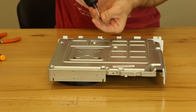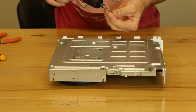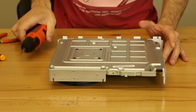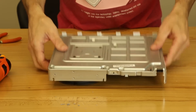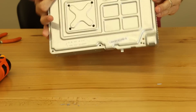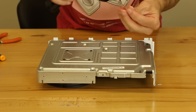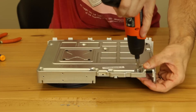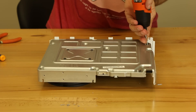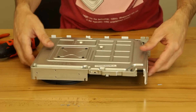So you don't actually need the security bit for most of the Xbox One S. There's two. So then we've got two more to put in. I use this electric screwdriver — it doesn't have a ton of torque on it. So what I do is just tighten it until the screwdriver starts kind of loading down, and then I call that good. So now our motherboard is mounted back into the bottom case correctly. So the next thing we're going to do is these larger silver screws go in here and over here. There's a B1 and a B2 right here. So that fully mounts the motherboard into the bottom case.